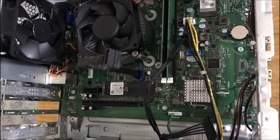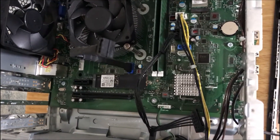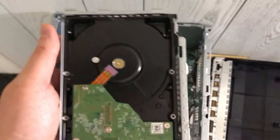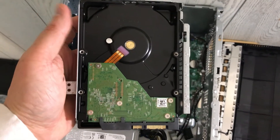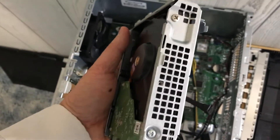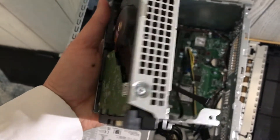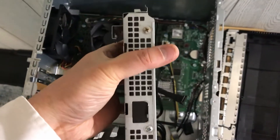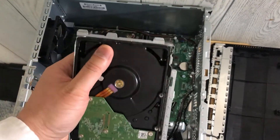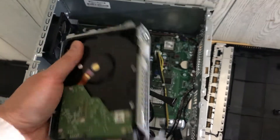Let me put the hard drive into the bracket and I'll come right back. I already put the hard drive into the hard drive bracket, and this is how I secured it: there's one screw, and then on the other side there's a third and fourth screw. Now the hard drive is securely locked in this metal frame.